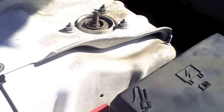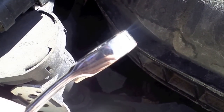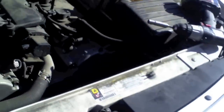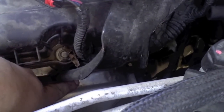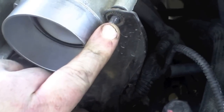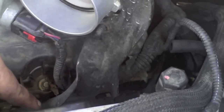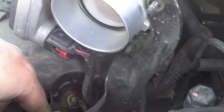I've gotten these two nuts off - right here and right there - they're 10 millimeters. You're never going to get to this one without a wrench. I love my GearWrenches - this one's a 10 millimeter, it's reversible and angled. If I had to get one set this would probably be it. You can flip it back and forth with the flick of a finger. I figured out I probably need to undo this bolt way down here to free this bracket because of these studs.